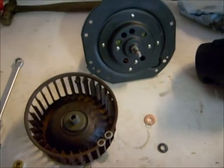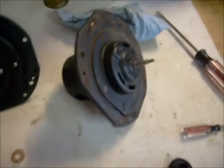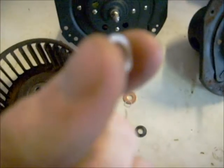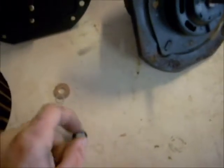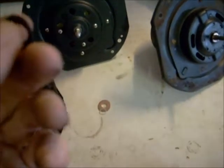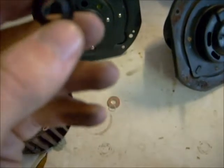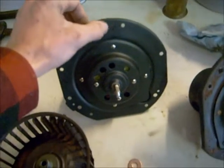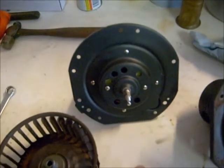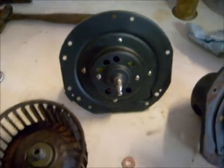Alright, I'm back. Got it apart — had to use the hammer again for a little persuasion. Got all the hardware off the old motor shaft. There are three of these real thin nylon washers. I'm going to put those on there on the new motor shaft, then this copper bushing and then a retainer — just got to go with the concave side down. Push it on there — it'll keep your stuff from sliding off. Put the motor fan back on there and the nut. I'll show you how it all looks once it's put back together on the motor shaft.